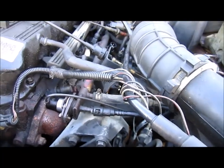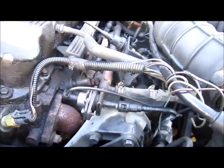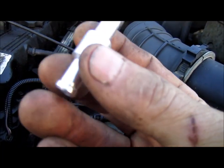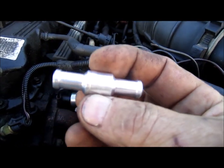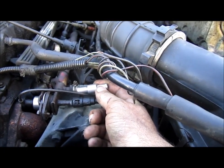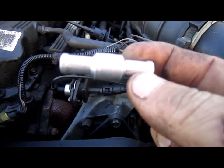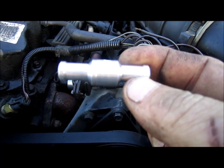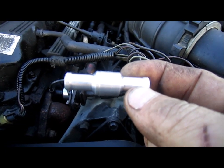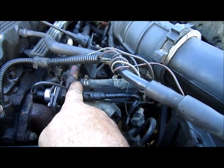So what I'm going to do — and what I want to share with you, and you might want to try — is in this line right here, close to the engine, I'm going to put this little one-way valve. There's an arrow on it so it goes in the right direction. What that's going to do is when the fuel pump pushes fuel toward the motor, once it gets past this valve it will not be allowed to back up, which is going to keep pressure in the system, because that pressure may be leaking back out somewhere between this point and the gas tank.